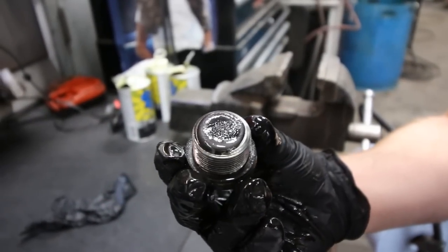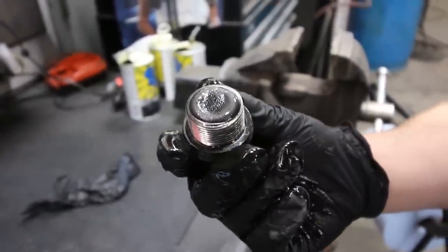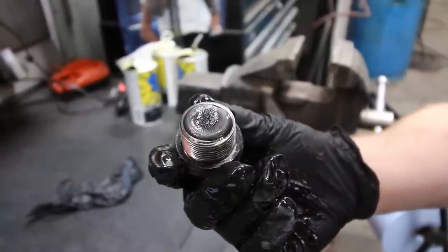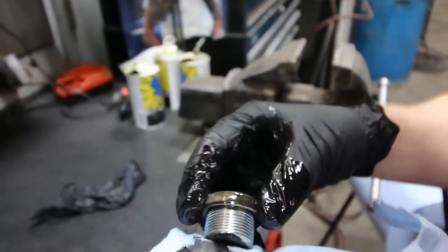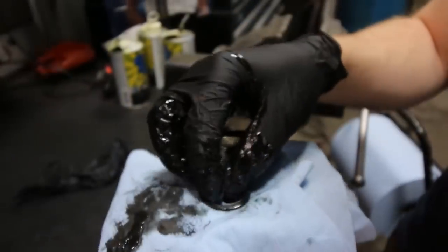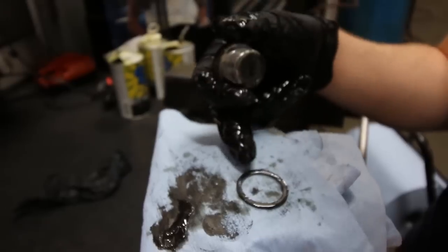This is what the drain plug looks like — you can see there's actually a little bit of shavings, not as much as I kind of expected. I'm currently at 60,000 kilometers on this car, so that's the right interval, right when you should change it. There's some sludge but not as much as I actually expected, so that's pretty good. Don't forget to remove this washer — you don't want to accidentally double up. I picked a new one up at the dealership for only four dollars.